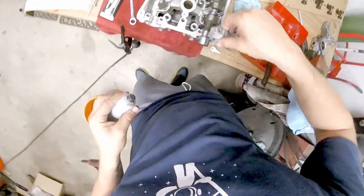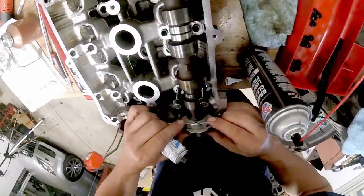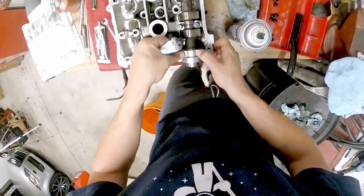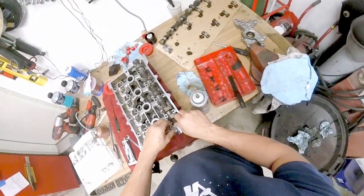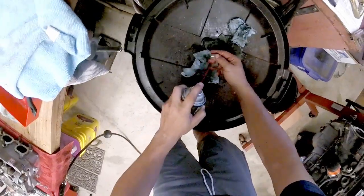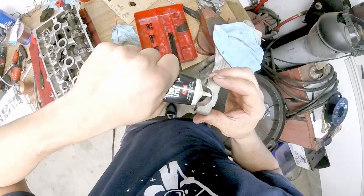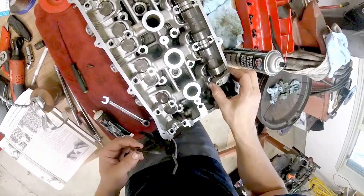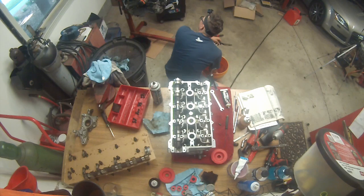Install the caps in the same order you took them off in the same orientation. The first bearing cap gets a thin consistent coat of RTV — it seals off the area between the cam gear and the inside of the head. Put it on finger tight before moving on to the next bearing cap. All the subsequent bearing caps are cleaned in the same way, one at a time, in order from front to back: brass brush, a little bit of kerosene, a little bit of brake cleaner, microfiber, a little bit of compressed air. Don't forget assembly lube on the underside of every cap before you finger tighten them.